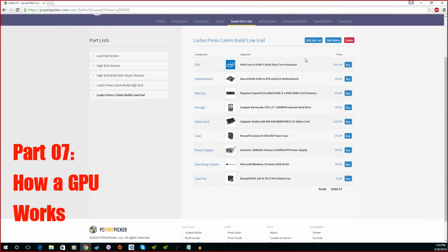Right. So low-end video stuff can be done on the CPU through the software. You don't necessarily need a video card to display video on your system. It's when you hit a certain level of fidelity that you're going to need a video card. Right, because, in fact, every motherboard should have some kind of dedicated video output, whether it's VGA or DVI output. AMD includes an integrated graphics card of its Radeon line on all of its motherboards. Intel has their own integrated line. Neither of those are very powerful, but it's worth mentioning that there are very basic integrated features on standard CPUs to allow for video playback.